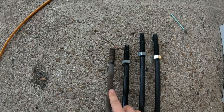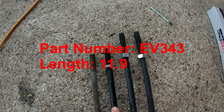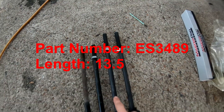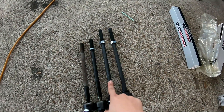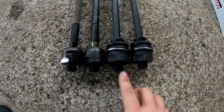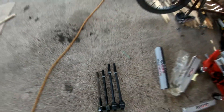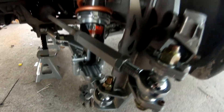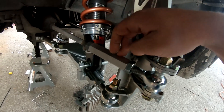This is the vet nuts one I cut. This is a stock Corvette tie rod, and these are actually $19.99 Sierra — I believe — tie rods. These are the exact same on both ends and will extend your tie rods about two inches. So if you are looking for extended tie rods for your Corvette, that's definitely an option if you want to have more thread inside of your tie rod adjuster.